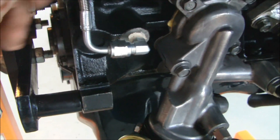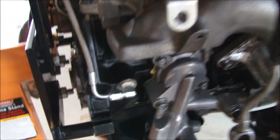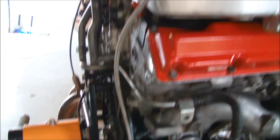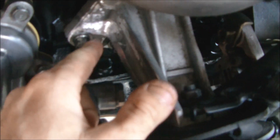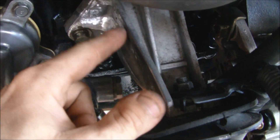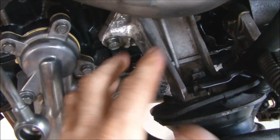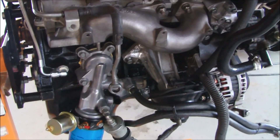I put the braided line on there and the thread-locking sealant in. This goes up to the turbo to supply the oil line. Now here you can see where I had to cut out a part of the bracket — I had to cut it because the wastegate down there on the turbo wouldn't fit because the turbo is so big. You can get the BDE motor mounts, but they're a little too expensive, so I just cut it out. Takes two seconds.